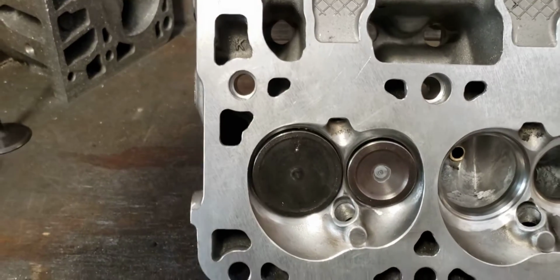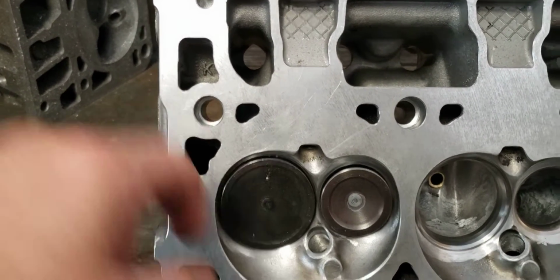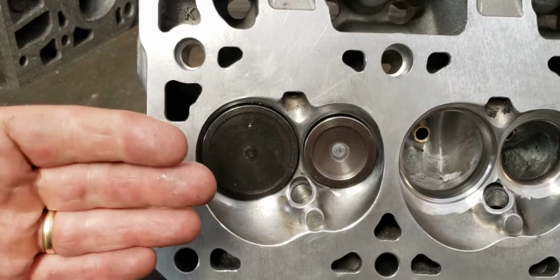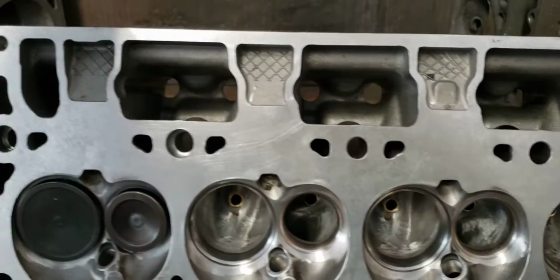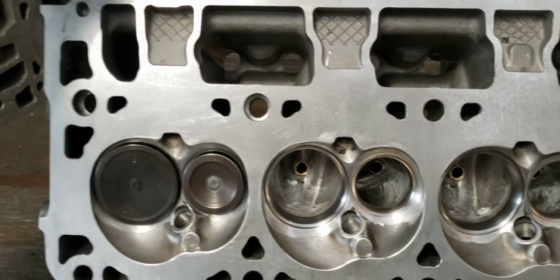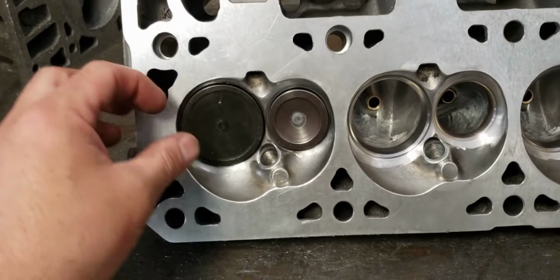The air in here is stagnant. It's not going anywhere. It's being pushed against the back of the intake valve, waiting for the intake valve to open. The reason I say pushed is because it's being pulled by subsequent cylinders through your intake manifold to your intake port, and it's just a column of air waiting to sit there to go into your intake port.